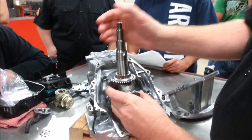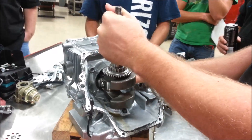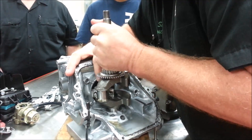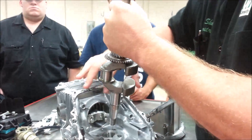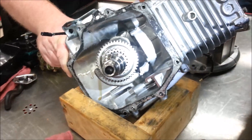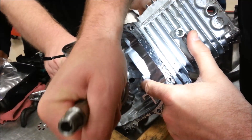The trick here is you're going to hold this with your hand, and I'm going to spin this around, supporting it so it can't scratch anything. I'm going to push the piston up into the cylinder as far as it can go, then swing it out of the way and find a sweet spot to slide this out. Do you see how I really had to be careful to move things out of the way? Notice how close that crankshaft is right here — if I go banging on this thing I'm going to cause damage. You might have to move things out of the way to find that sweet spot for removal.